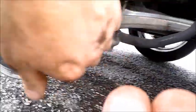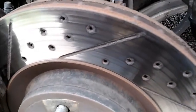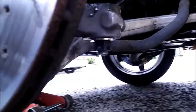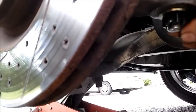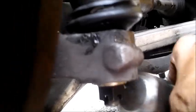Push it in — you can actually move the steering a little bit if you have to — then put the nut on. Only issue we've had so far is the brand new nut that came with the part doesn't fit. So let's just get the old one back on and then we'll put a cotter pin in there to hold it. Get the little hole lined up and put the cotter pin in. It doesn't matter which way the cotter pin goes in the hole.